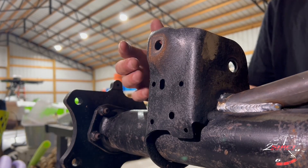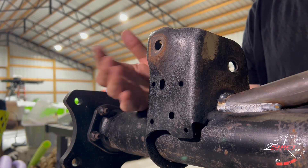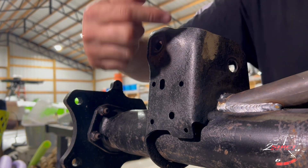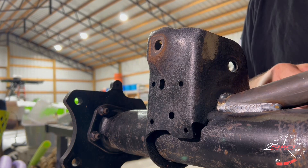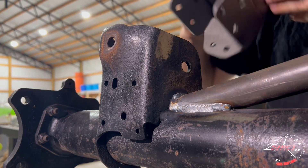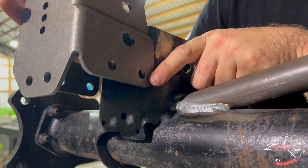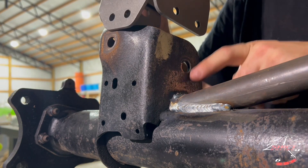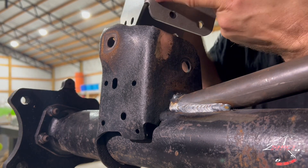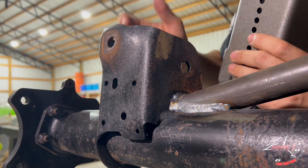In the instructions it says you have to cut off this back hump right here — this is where the stock shock mount goes. There's a swell right here, so what you need is for this back bracket to be flush and flat. I'm going to have to cut out this whole section. I'm going to mark it and show you, as well as mark where to cut to accommodate the team z-bar.